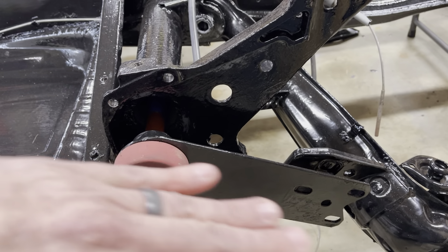In reality, if we follow that table we should be able to set our ride height to whatever we want. So our first step is to level the chassis front to back. I have my digital level — this one is really nice and cheap on Amazon but works really well. I'm at 2.1 degrees. What I'm going to do is zero it out, so this becomes my new zero degrees, and when I come back to here following that table.